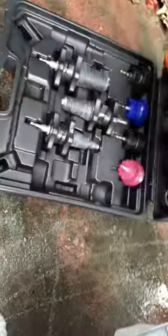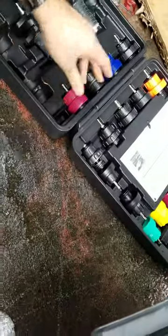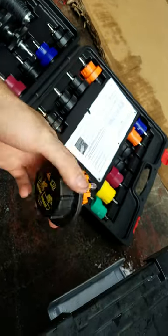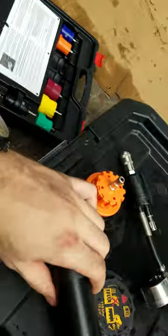You're going to need three main things from this kit: that being a number three — the yellow one — another yellow one that's already on the reservoir bottle, and you're going to need a number 24 to test out your caps to see if those are building correct PSI, as well as the pump.